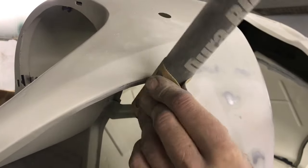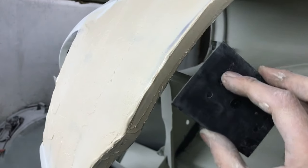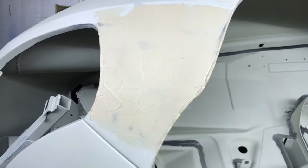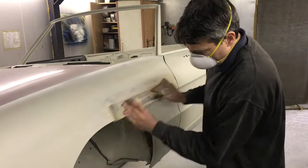Like I did with the filler applied away from the body's swage line, the same rule applies to edges — apply it at the edge and spread away from that edge. You want to build a sharp corner, which helps with seeing if the corner is uniform. The sharp edge can be taken off later.